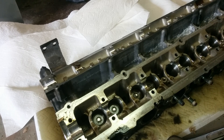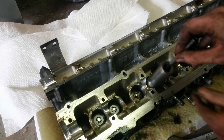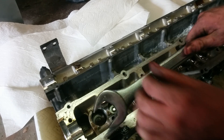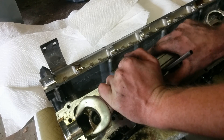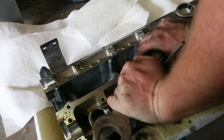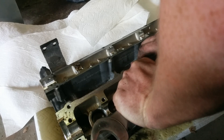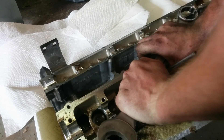Make sure the magnet pin goes all the way through and get it to where it's going to be on top of the valve, so it'll have contact with the keepers. Then you put whatever object you have on top of the socket and you push down. It might take a couple tries, but you'll feel it.